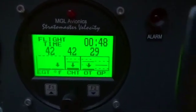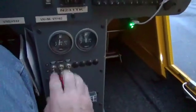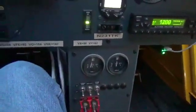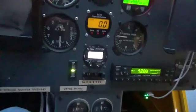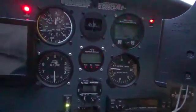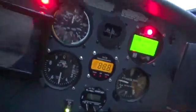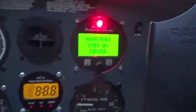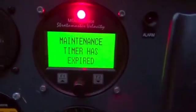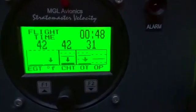Let's see what our monitor gives us for a temperature reading. 31 degrees. Okay, so it's come up from 27 to 31. I'm going to leave the ignitions off and cycle the starter for five seconds — maybe that'll get some oil from the tank into the engine. Five, four, three, two, one. Now let's see what we get. Still 31.